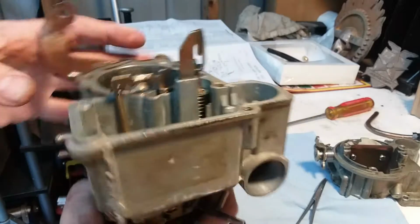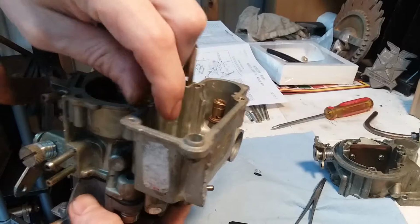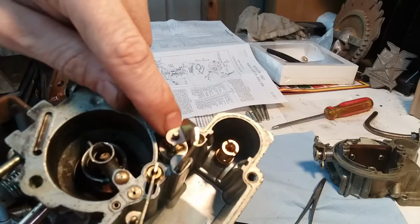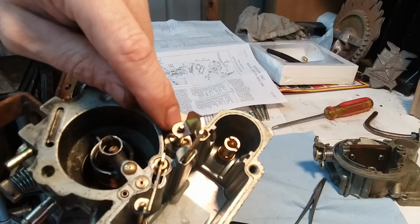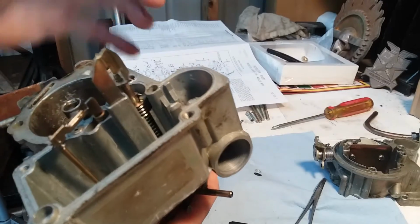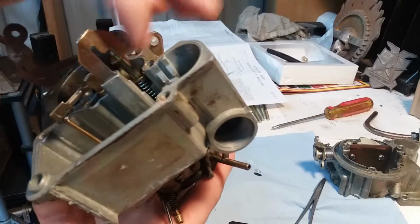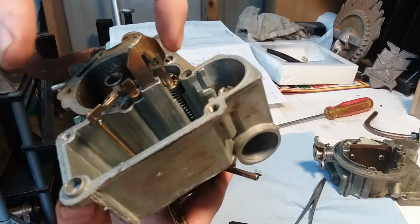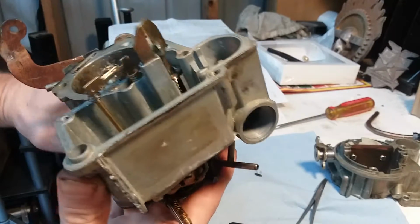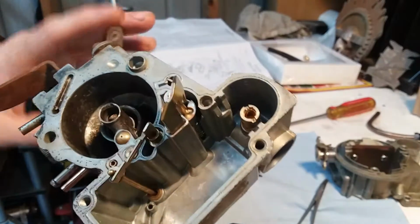It's very important. And there's a spring in there at the bottom. You have a little spring here, and then there's a spring. There's actually two springs in here. There's a main spring on the body of that pump, and then at the bottom of that pump too. And then this fits in here, right in there. Now, the rebuild kit comes with a new rubber part of this pump. You don't want to put oil on it. But you just want to make sure once you get in there, you want to make sure this moves easily, and this does. So that is a success.